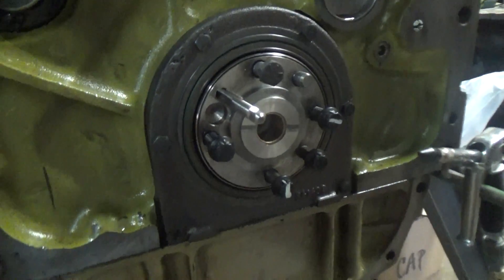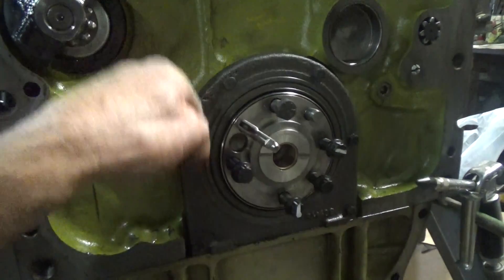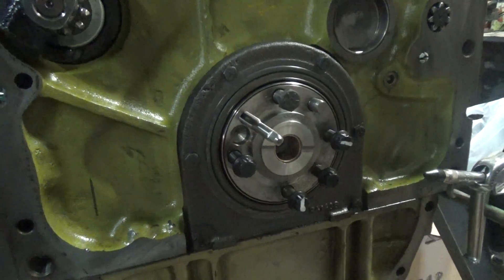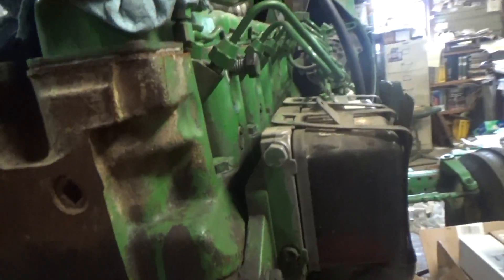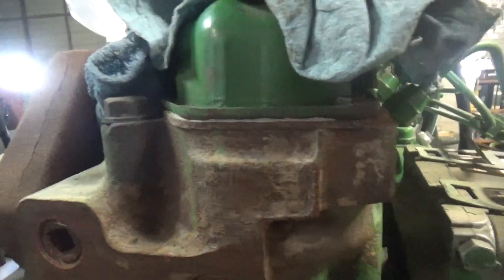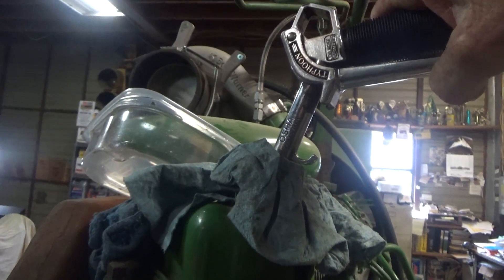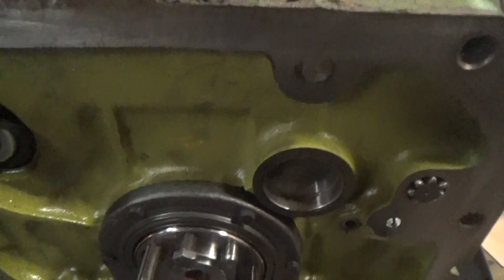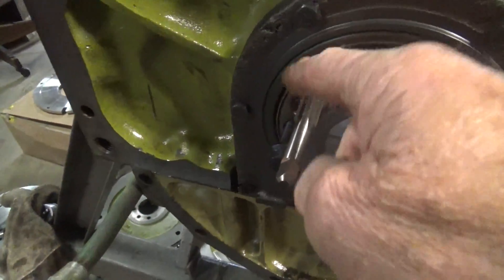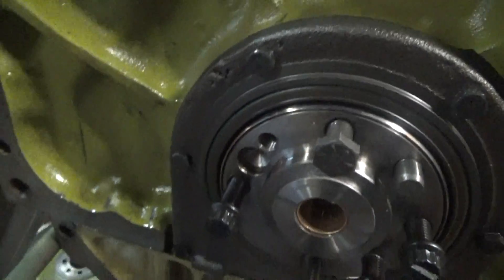How do we keep the chips from both drilling and tapping these holes from falling inside the engine — the metal shavings and all that? Well, we simply took the air hose and this is the crankcase ventilation hole, and pressurized the crankcase with compressed air, and let the air blow out through here. All the chips, all the metal shavings blew everything this way instead of going down in the engine. Thought that was a pretty good way to do it.